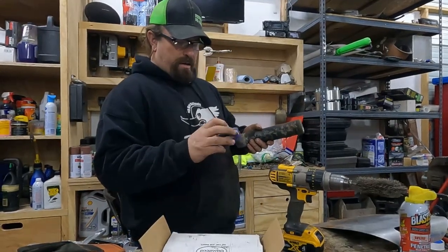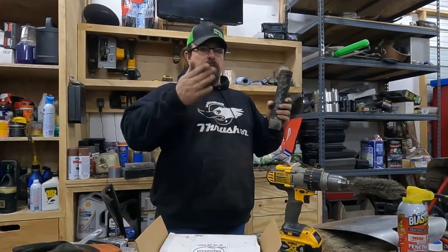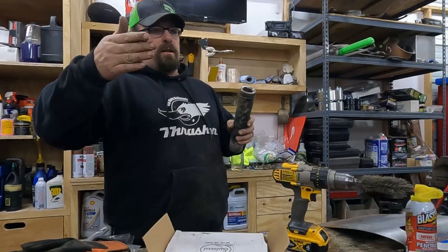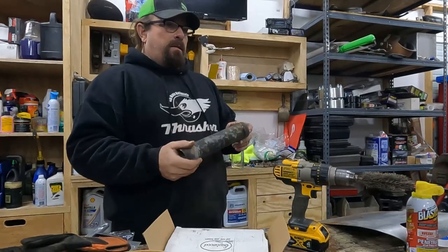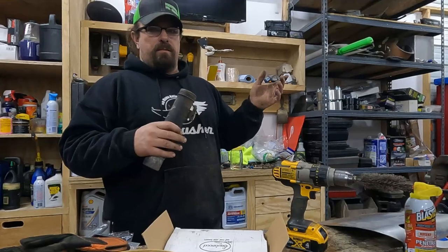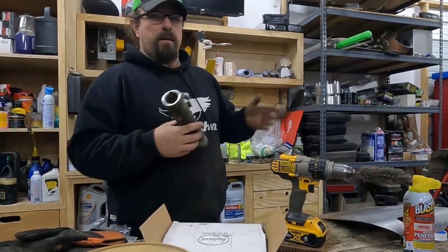All right, so now we're gonna go see if we can get the tank in. We're gonna have to modify the straps because where the bend is at, the tank is gonna end up loose in there. So what I'll do is I'll put a new bend in it, put another bend in it, drill a new hole, and just make the tank straps a little bit shorter to fit that smaller tank, which there's no way it's 15 gallons because it's not as wide, it's not as long, it's not as deep. But they're both 15 gallon tanks. I don't know, you do the math.